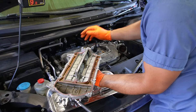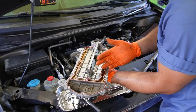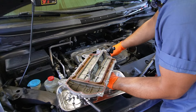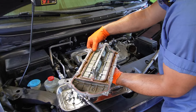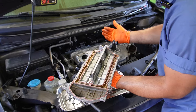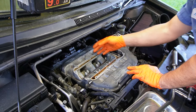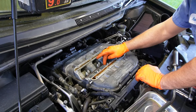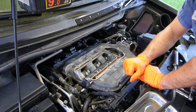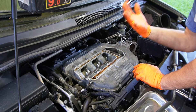When you remove the top of this plate, there is a gasket, and I would recommend replacing it. If it's been replaced recently and looks good, you could reuse it. But if not, you should replace this upper gasket and even the lower gasket. This is very critical because if there's air escaping into here, it could cause your car to run lean or run rough. Also, inside this valley there is another gasket — keep this in mind, don't lose it, because you can lose it in the process of removing the intake manifold.